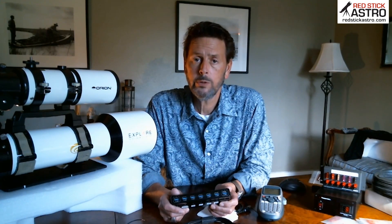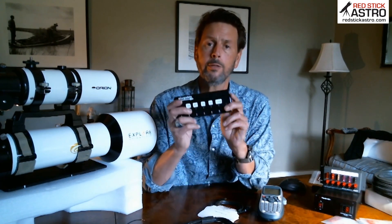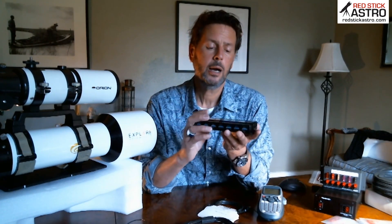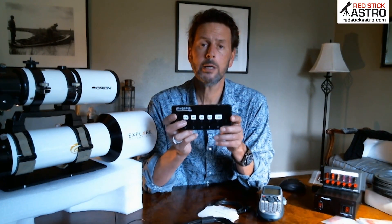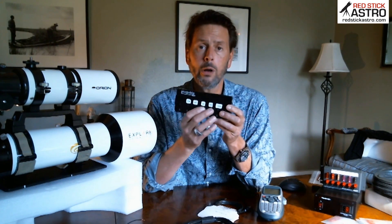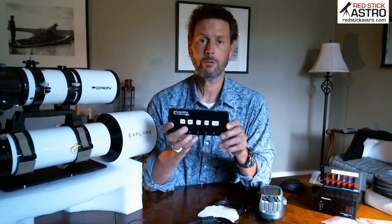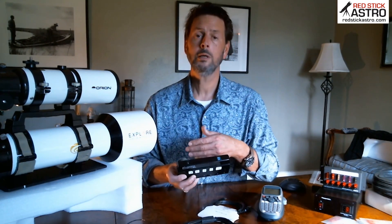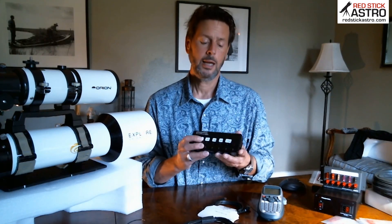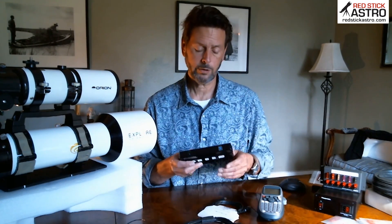You've got to look at what you're going to do to put your data together. What I used was a USB 3 powered hub. I chose a powered hub because I want to make sure that all my transfer rates for data have all the ability to transfer at the rates that they want. When you start stacking up a lot on a passive hub, you could get some corruption. USB 3 will also talk to your USB 2 devices so you still get all those fast transfer rates and it works with your old stuff.